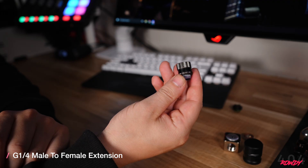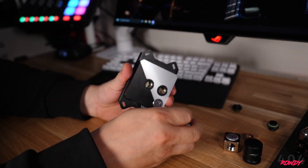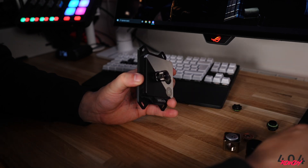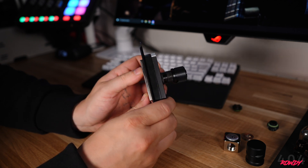To wrap this up we've got a couple more to go through. This one is an extension — a G1/4 male to G1/4 female fitting, essentially a giant spacer. If you've got a very small gap to fill where you don't want to use hard line or hose — which can make things look busy and untidy — these extensions are absolutely great. I tend to use them with radiators depending on where I've mounted them, just to give more clearance away from the radiator without using hard line or hose. They come in various different sizes depending on what you need.